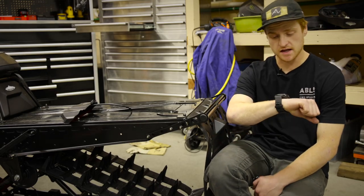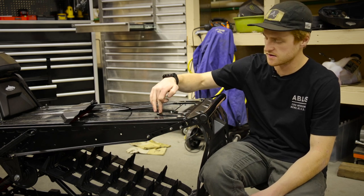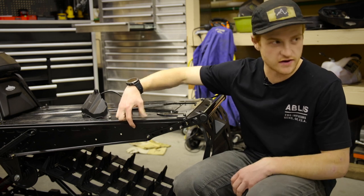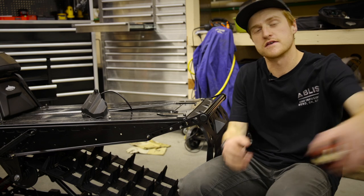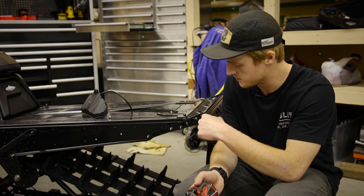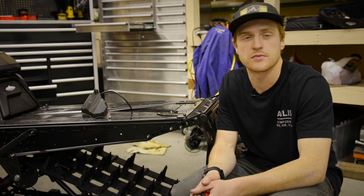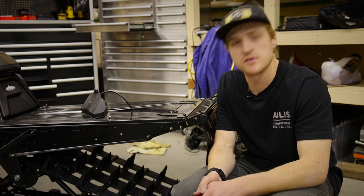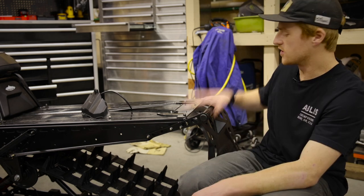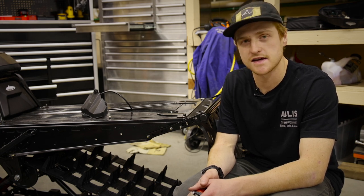There you guys have it — it is 11:58 PM, got it in before the day ends. This is the final look. I still have to add a rivet here and figure out what to do with my taillight, but we got the three inches we wanted. Measured from the finished rivet to the end of the bumper: 12 inches. The stock 155 behind the camera is 15 inches from the same reference point — so we did it, three inches cut off. The bumper is also a little bit higher, which is a bonus. No cutting into coolers, no antifreeze, no extra parts — just a couple extra bolts and some rivets. Is it the prettiest thing? Maybe not. But it'll get the job done.